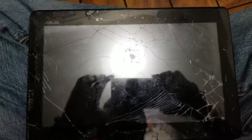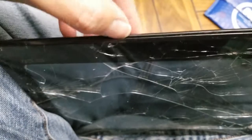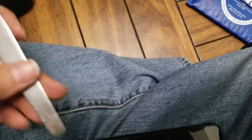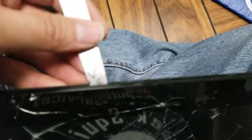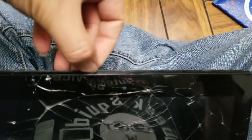Eventually you can get all the way around. But if you want to do it without cutting the cable — since you're going to have to replace the new cable anyway — there's a gap between the two layers here. You can stick your nail in there and just pull it back like this, or you can use a pry tool.